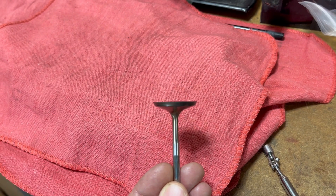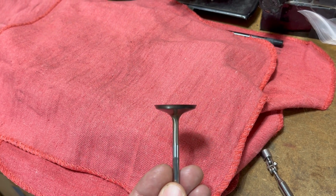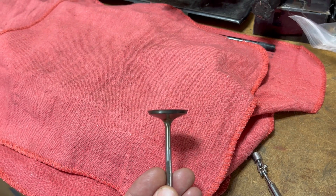I'm not exactly sure what's going on with the metallurgy of these, but they are not good. Every single one of them was pulling through the head, causing me to continually adjust the valves. I couldn't figure out what was going on until just recently — the reason I figured it out is because this is happening to other people too. A major aftermarket parts supplier has had this happen to two of their heads, one modded, one stock, except for these valves. And another guy on Facebook recently said the same thing.